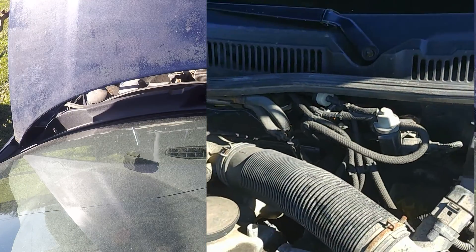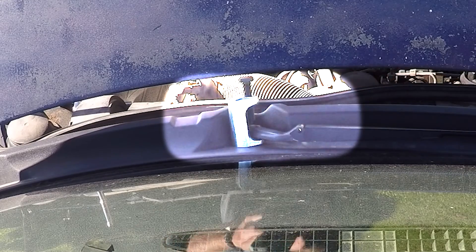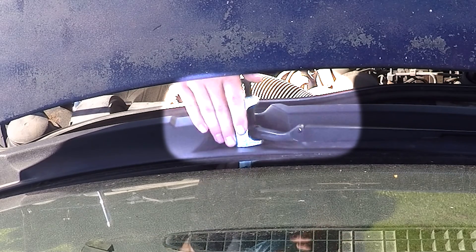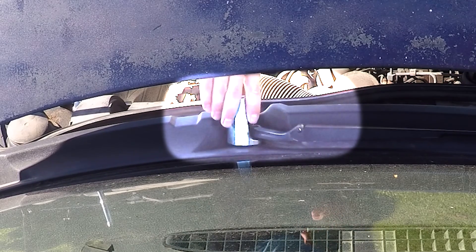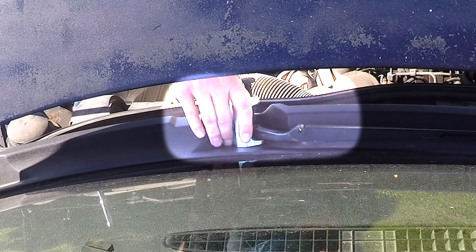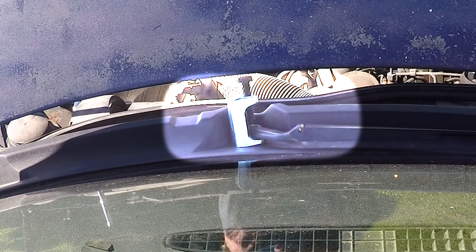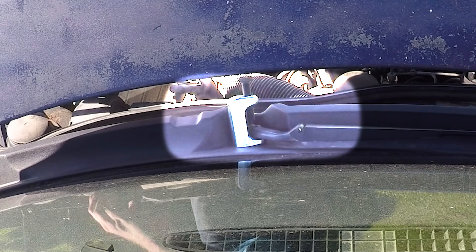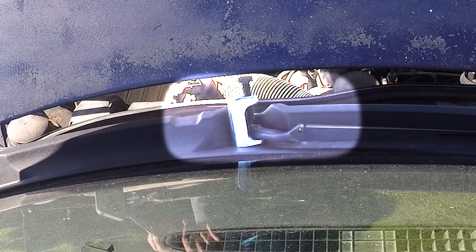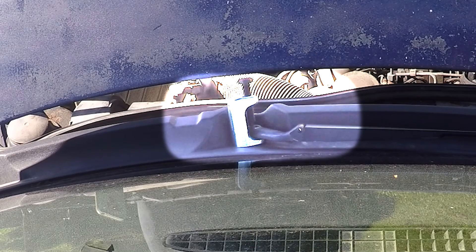So that's one wiper done. Now try exactly the same thing on the passenger side which is a lot harder to reach of course, but the puller fits on it a little better. I say that but we're not actually anywhere close to the center of the stud with the puller, so I'm not sure whether that's just because of the cowl. You just have to play it careful - if you can get a hand on the cowl to hold it while you tighten it you might be able to make it work, but mine looks like it's going to slide right off the post.